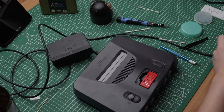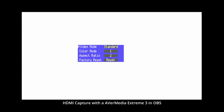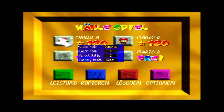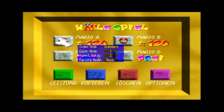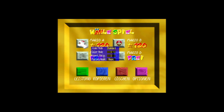Now with everything working, let's take a look at how it's performing. The menu, which you can access by pressing Start, A, and B at the same time, is quite simple — navigate with the C buttons. The video mode seems to be a contrast setting while color mode offers different color filters. The only thing I really care about is the aspect ratio option. This mod outputs a 720p signal: mode 1 leaves the original aspect ratio untouched with a black canvas around it, mode 2 stretches the native 4:3 to 16:9, and mode 3 seems to overscan the image — at least on my PAL region N64.